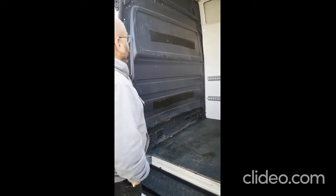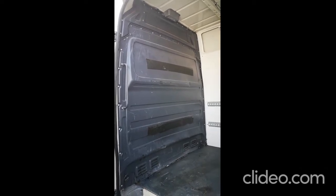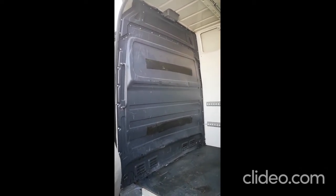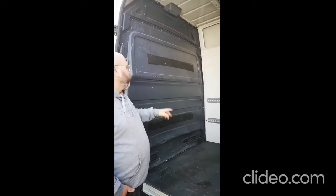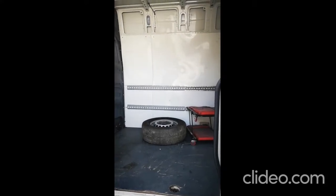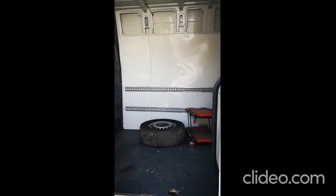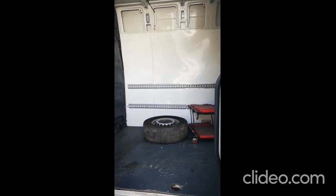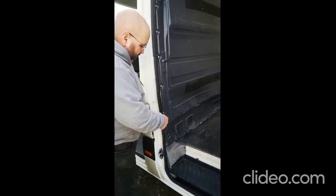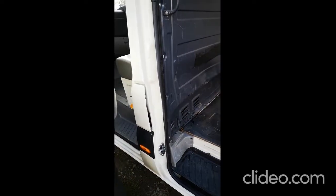The Crafter has a full-length bulkhead that will come out today, held in predominantly with T25 screws and 10mm bolts. One thing to bear in mind is that you need to keep the top of the bulkhead if you want to use it as a pattern to put a cupboard into the roof space later. There are also a number of tie-down channels which need to be removed - they're riveted in - as well as this white plastic coating in place of ply, which also needs to come out. The foot of the bulkhead folds over into the cab, so you need to start in the cab to loosen that off first.